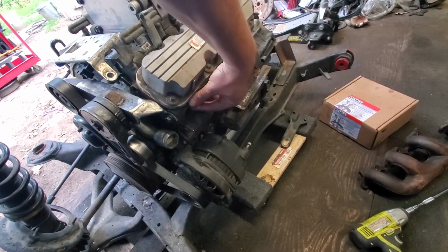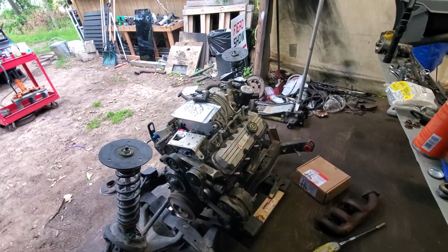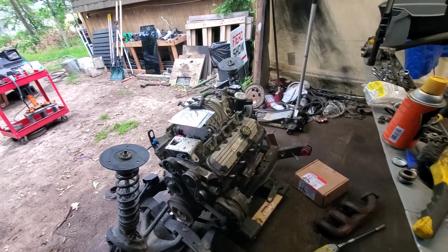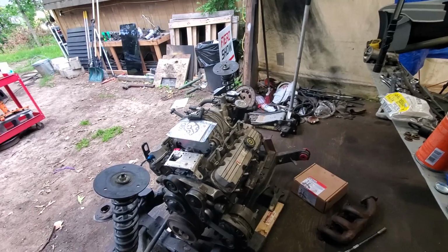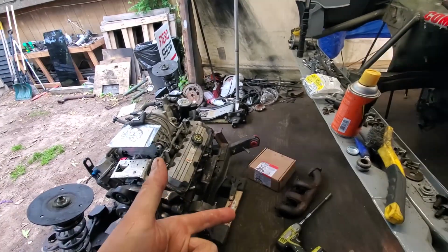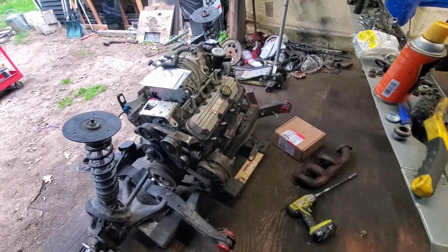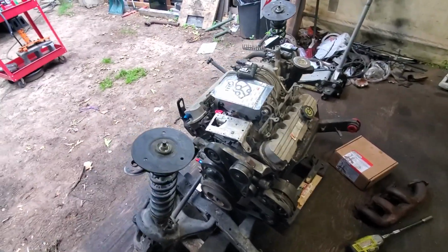Is there even like a... Oh, there's a gasket. So, I'll have to pick up a set of exhaust manifold gaskets for this thing. And I'm pretty sure I'm going to just leave the manifold off until I go ahead and get some exhaust wrap, because I have to exhaust wrap that for sure, because it literally makes contact with the alternator. Well, it doesn't make contact, but once I put exhaust wrap on it, sure will.